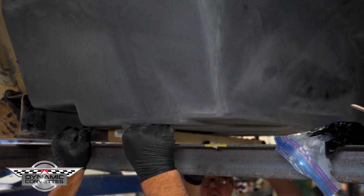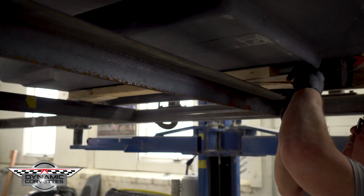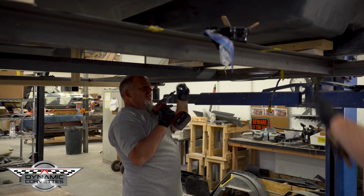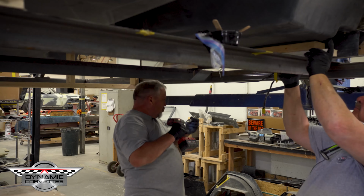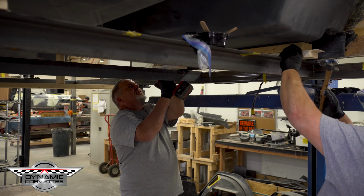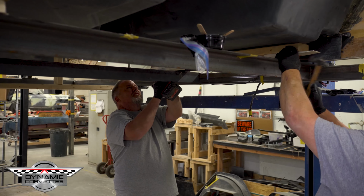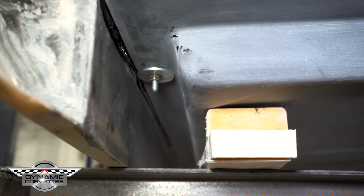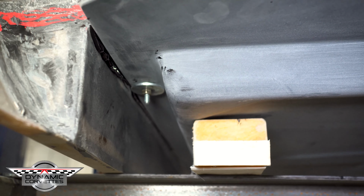Now, something you want to keep in mind here is we're doing this with epoxy. We're not doing it with a polyester product. And we have a nice pot life on this, so we're not being rushed. We have our 2x4s against the floor surface, and our fixture going across the bottom of those. We've added our wedges, and we've tapped our wedges into place to put an upward pressure on that floor so we get a nice good bond. And you saw the way the bond oozed out on both sides. Pretty comfortable. It's nice and equal.